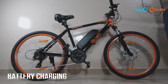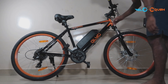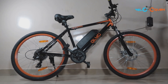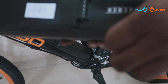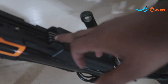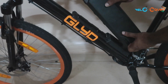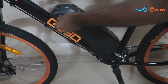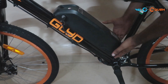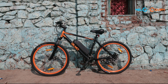When it comes to the battery, there are two ways you can charge it. One is to leave it mounted onto the bike and simply connect the charger. The other way is to remove the battery from the bike cradle and charge it. To install the battery, look at the back — there are four grooves, and the battery cradle also has four similar grooves. To lock the battery, match these four grooves and slide the battery down. If you want to remove the battery, use the keys that come with the bike, put them inside, turn and lift the battery up. And that's how you take care of your electric bicycle.